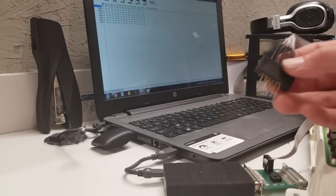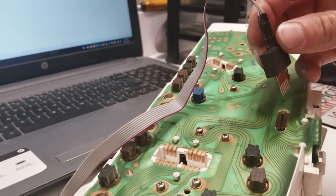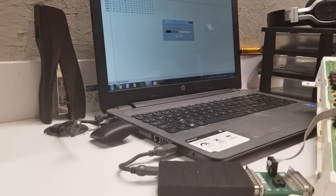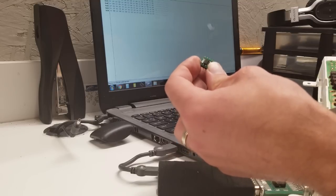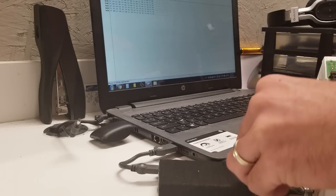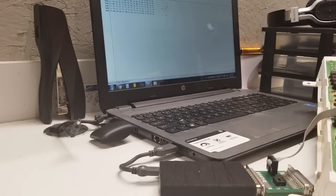So many clusters are programmed using this adapter. It goes right into this slot right here and makes contact with the circuit board. As you can see, the file is mostly empty. So for some reason this programmer doesn't let me open files — they would be displayed here. What I do is I have a chip that has a good file on it, so I just insert it into the programmer, read it, and then write it.